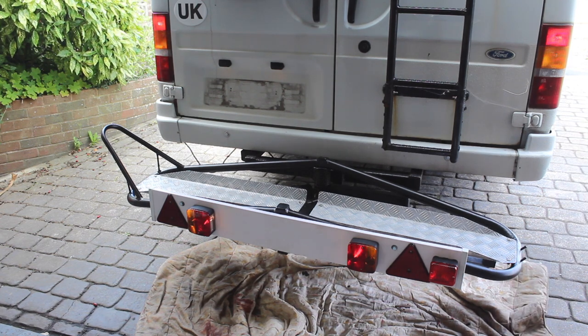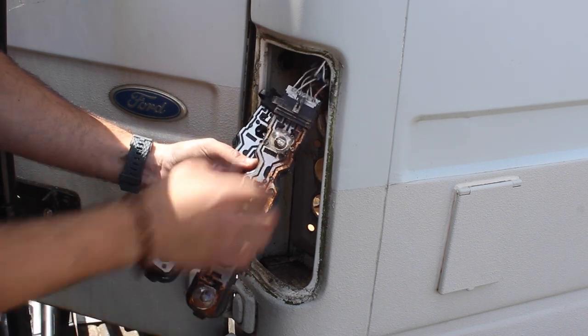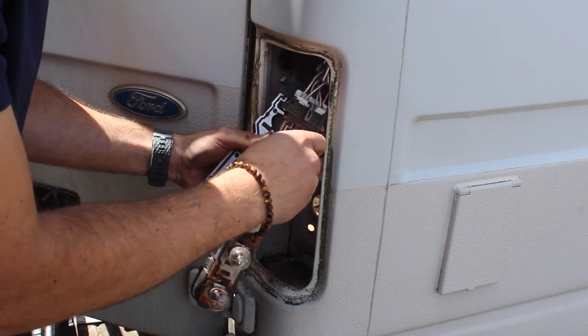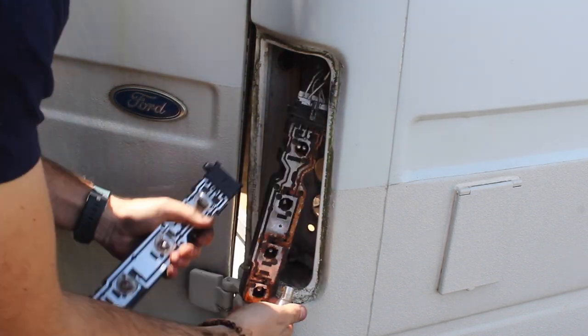It's like a disco — that's a bad earth I think. When taking the rear light cluster off, I found lots of corrosion on the lamp holder, so I swapped that out for a new one on both sides. Unfortunately, we still have the problem. It has improved, but it's still not perfect, so it's going to need a little bit more thought finding the bottom of it.